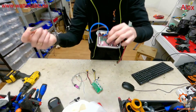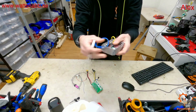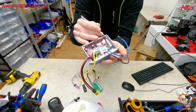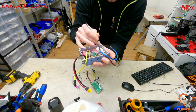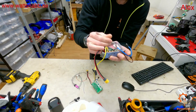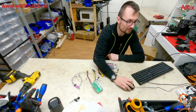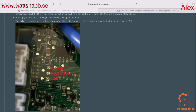They are right here. For the five volt connection — the last pin is five volts. So you have five volts here, GND, and the other pins. When you connect it to ST-link, you can see my video on how to do it on YouTube.